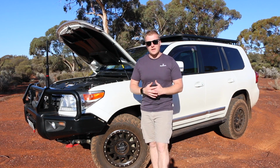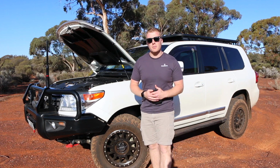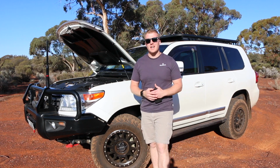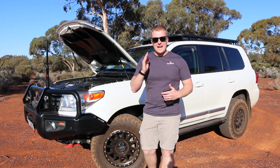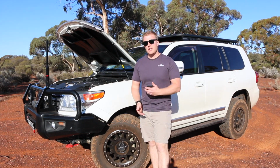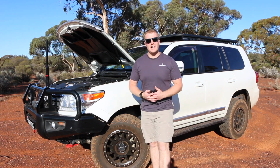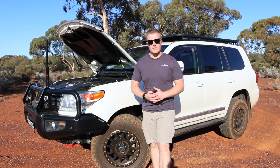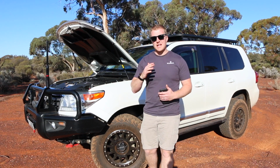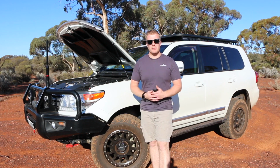Now on these particular vehicles that probably will result in some sort of fault code. But you do have to keep in mind that at the high speed automatic function, this won't occur. It locks in at 82 kilometers an hour and unlocks at 78 kilometers an hour, and this means that the engine will never be in those low RPM lugging away. So if you are going to use the low speed functions, you need to drive the car in a manual mode just to try and keep those RPM above say 1500 to avoid having any error codes pop up onto your screen.